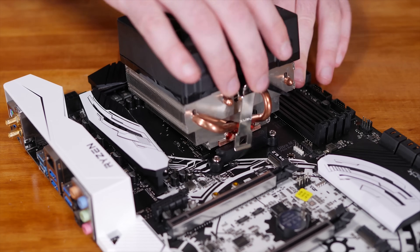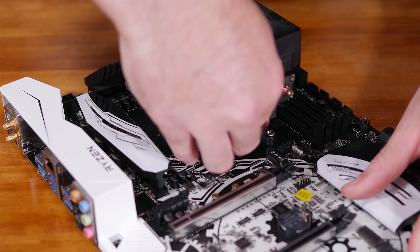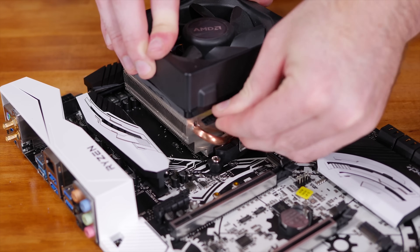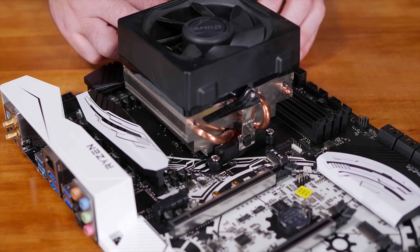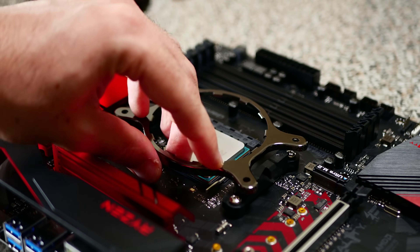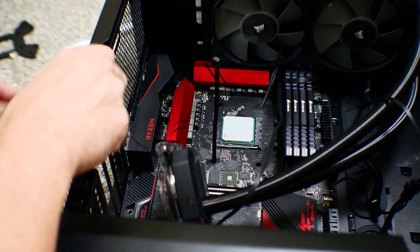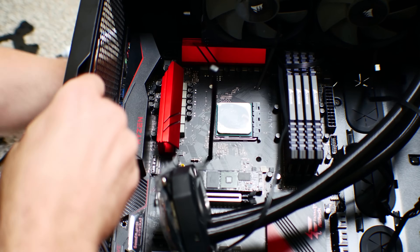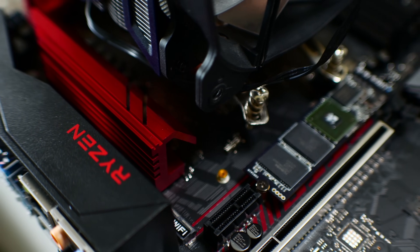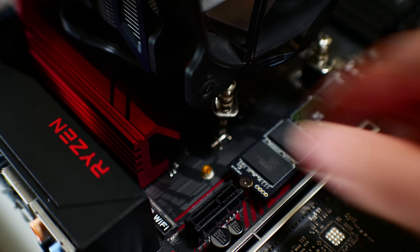Bolt-down coolers will unfortunately not fit the AM4 platform, unless the motherboard manufacturers have the AM3 holes drilled out as well as the AM4 holes. The AM3 holes are a little bit longer in length — they're kind of a similar structure — but I've found that I had to zip tie my cooler down. I've tested out quite a few coolers, and I even managed to get this Cooler Master 212 to almost fit, but I would have had to pretty much ruin the bracket to get it to fit in even only one diagonal direction.